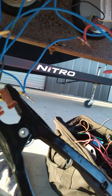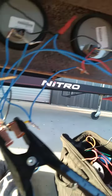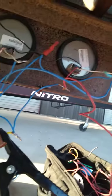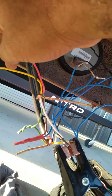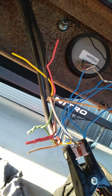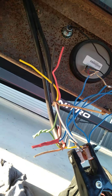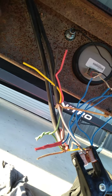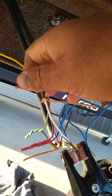The white one is your ground. And for another function, this one is for your right — driver or passenger side — light, or right one. This one is brake and signal lines, and this one you can use for the power or the battery.